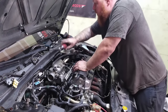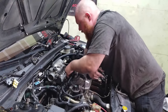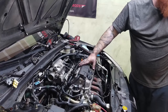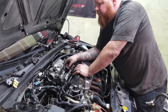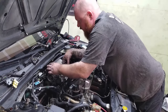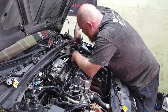Okay, so fuel injectors, these fit, at least. We got one thing that fits. Okay. And then, I think, where's that throttle body? Yeah, so this is for the map sensor, or the TPS. Mm-hmm. We got our nice little extension harnesses right here. Let's see, TPS. Yeah, it's a little too short. And then we have the map sensor. It's also too short, but I can open up this harness shield. And I'm pretty sure that we have a little bit of slack in here.